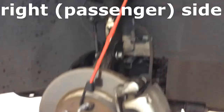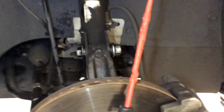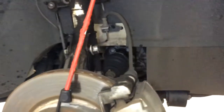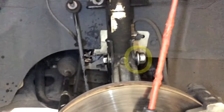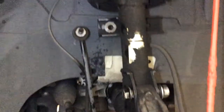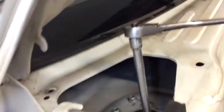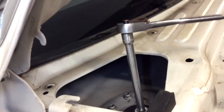Propping up the knuckle. I've got it tied off just in case there's some issue, so the knuckle won't go flying. And you can see I've got the nuts matched up with the end of the bolt there, and I've used a hammer to get those out slightly, as you can see right there, exactly in the middle of the screen. So what I'm going to do next is take the nuts off, remove those bolts. And we've already removed the 18 millimeter nut that goes to the sway bar connection. And remember, the first thing we did was we took 2 out of 3 of the nuts on top of this out. As I move to the top, you can see in here I've still got the wrench on the last one. So we're just about ready to remove this one and put the new one in.